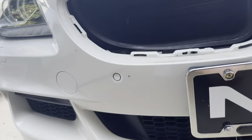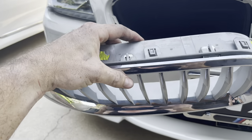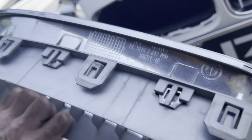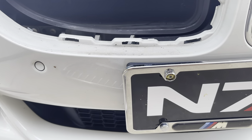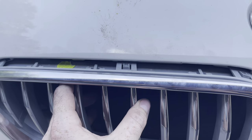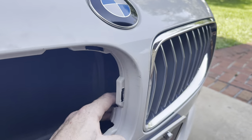First one's out — future site of my cold air intake. This is a pain to get out. The top ones and side ones aren't so bad, but the bottom ones you've got to really reach your hand all the way up in there to barely get enough pressure. I'd advise cracking the top ones first and getting those set, then working your way around, because the bottom ones are much more difficult to reach.